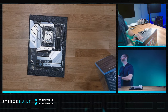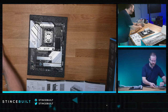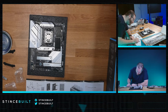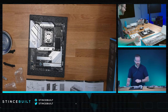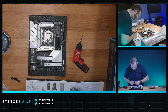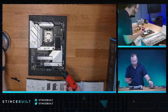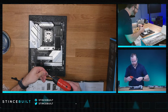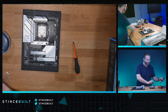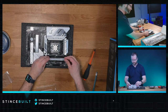Next are the cooler standoffs for the Galahad 2 LCD Infinity cooler. For AMD, they replace the factory standoffs with their own plastic standoffs but retain the factory retention screws. Pop the factory standoffs out, and these face up toward the CPU - easy. Next, we're putting in our Team Group Delta 6000 C30 RAM - boom, boom, down and in.